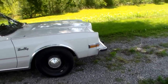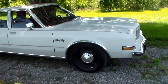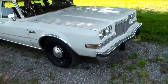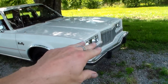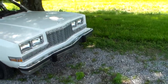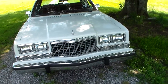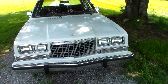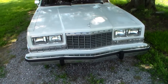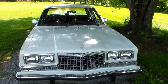The air conditioner is not working completely — it works out here under the hood, but there's no cold air coming inside. The air blows but it's not cold, which is a very common thing with these age cars. Since it's working up here, I'm not sure what's up with it. The compressor is doing something because the line from the compressor to the condenser gets hot, so it's actually pumping. I don't believe it's broken internally — it's got some charge in it. But I was not able to hook up my gauge set because whoever put R134 in it did a half-assed job and only replaced the low-side fitting, not the high-side fitting. So I'm guessing I'm going to have to go in and just redo this air conditioning system, because it's too nice a car to not have air conditioning.